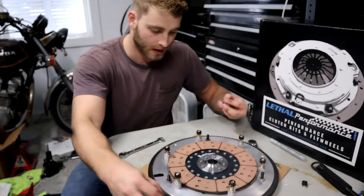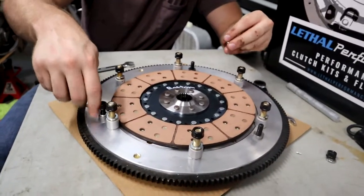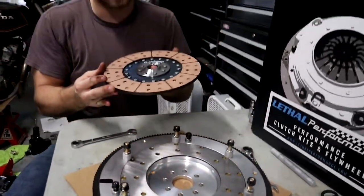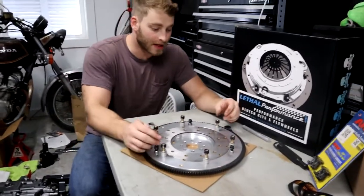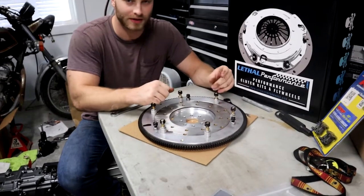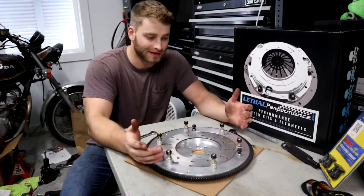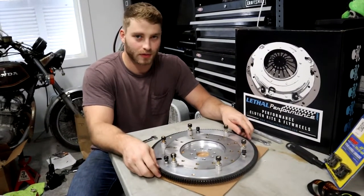And then we'll go ahead and throw our locking nut and our locking washer and our nut back on. And with that done, we've got our bottom plate that can now get out of the way. This one also says flywheel side on the other side. Now you don't necessarily have to be too cautious of touching our surface areas here. We're gonna wash them in a second anyways. If you got tons of oil on your hand, I'd probably advise against that part, but for the most part, you're probably fine.